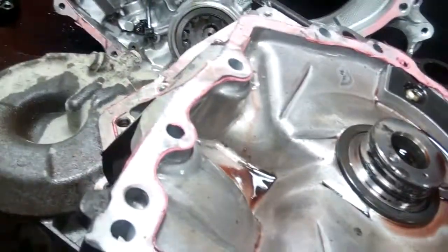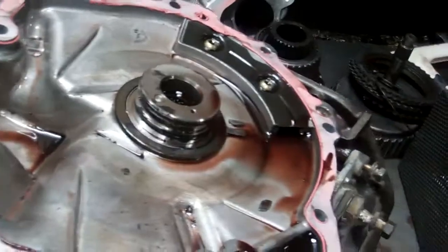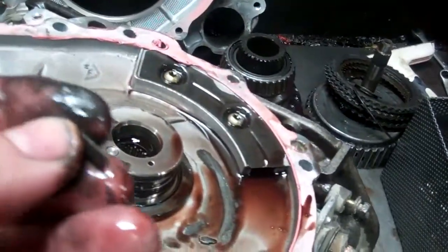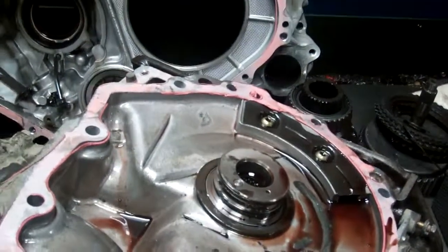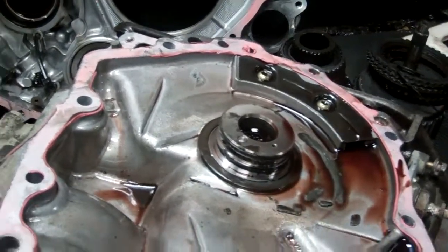The filter itself is going to be restricted as well, of course, but you know, that's kind of the gist of it. And we can actually see some other pieces that we were finding inside the pan as well, which are all related to that planetary failure. So it's a really expensive venture. Eric is going to talk to you about the different options at this point. Thanks.